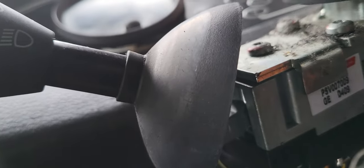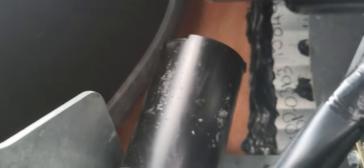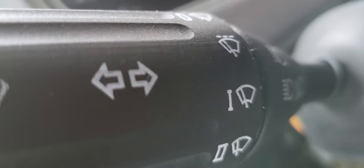That's how you diagnose a wiper that's not working. It's very common. If the wiper is not working, first tap the wiper motor a few times. If it's still not working, check the connector or check the wiper stalk. The last thing to do is check the fuse — I think that's the number 18 blue fuse on this panel here inside.